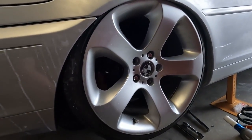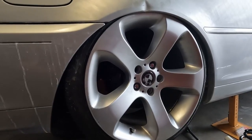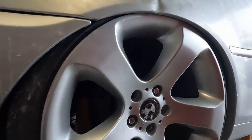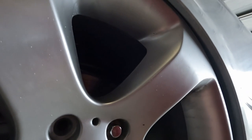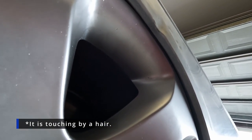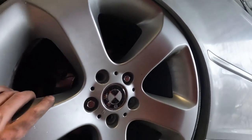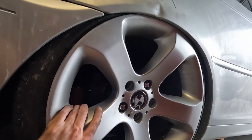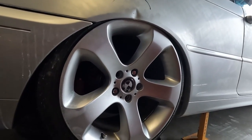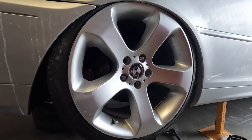Now this on the back is an X5 wheel, so it's a 19 by 10 plus 45. And you can see you have not got much room up there — you've got like a millimeter. This looks like the biggest wheel you can fit in the back because it's almost touching the inner body at the back. So rear fitment, and the best you can get without rolled guards is this.